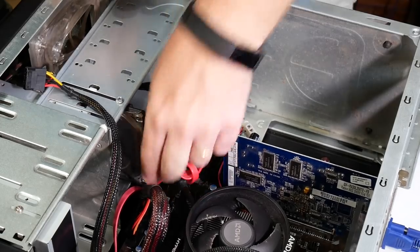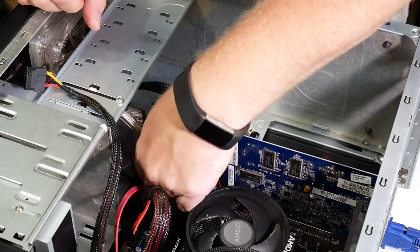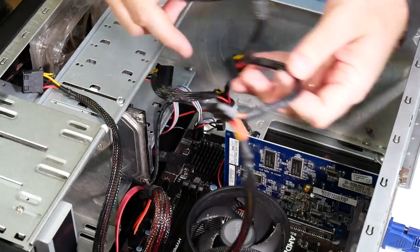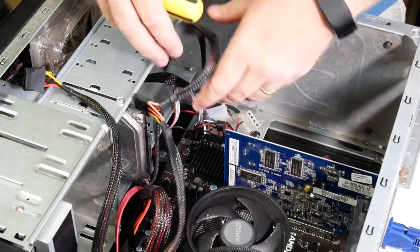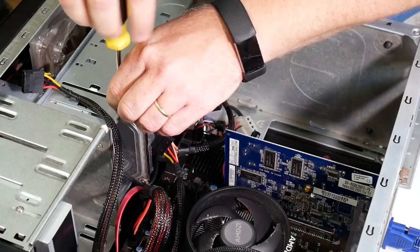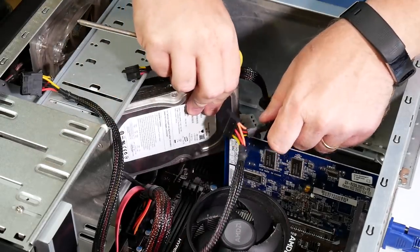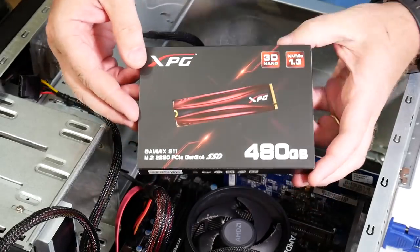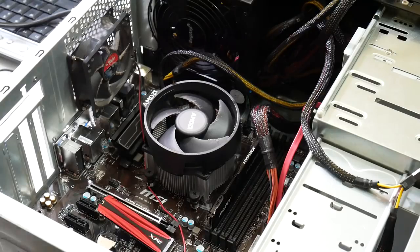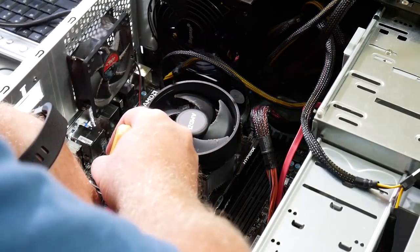So the first thing we do is remove this SATA drive. We need to unplug first of all the data cable, and now we need to remove the power cable. Obviously the cabling here in this PC is a bit of a disaster — we'll tidy that all up at the end once we've got everything nicely fitted. So let's undo the screws — just one screw keeping this in here. That's pretty easy. We'll just take that out and out should come the drive. And we're going to replace the SATA drive with a 480 gigabyte M2 module. Fitting these M2 modules is quite simple — there's just a little slot which you put the module in at a bit of an angle, and then you just lightly push it down and screw it into place with the provided screws.